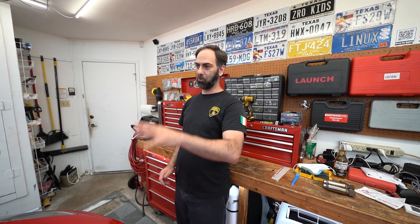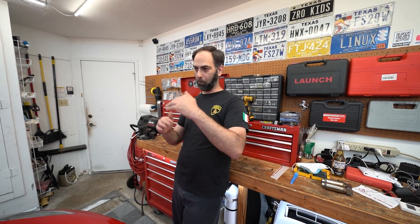The computers have the ability to sense knock and trim timing. So this car makes around 486 horsepower and the Scuderia makes 510 — right there we know there's 30 horsepower on the table. From experience tuning these cars, either a base tune with no exhaust mods or just cat mods will get you in the 20 horsepower window. But layering both on top of each other gets you into the 30 to 40 horsepower window. And on the Scuderia, decatting and retuning finds another 10 to 15 horsepower — so you can definitely find 40 horsepower in this car.